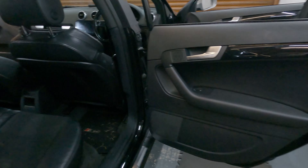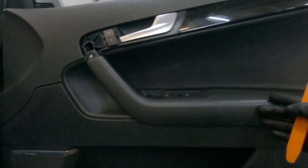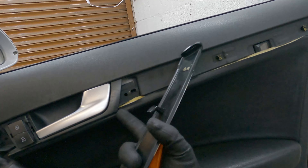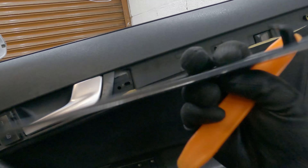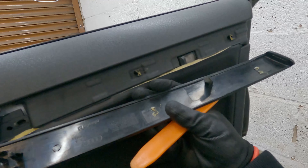To remove the doors it's actually a fairly easy process. I'm showing you on the driver's door, which is going to be a little bit harder. I need to get this little section off — on the driver's door that's all you need to do. I'm also taking this off because I need access to this area for the ambient light strip to go underneath. Looks like someone's been here before, actually, because there's glue here.